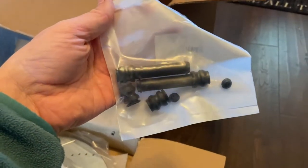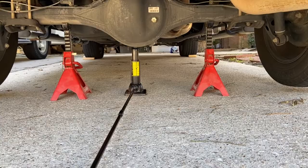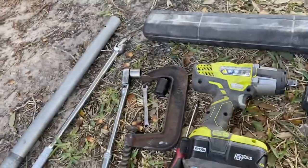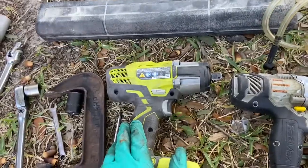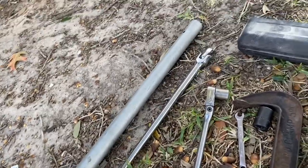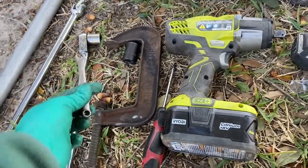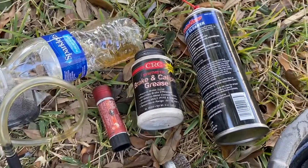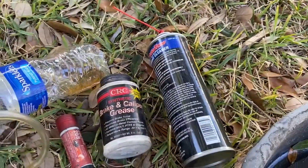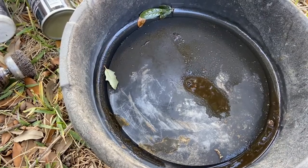Some rubber boots came with the kit, so we'll find out where those go. Car is jacked up with jack stands in place, wheels blocked. Tools you'll need for the rear brakes: 17 millimeter socket, half-inch drive impact gun — or a breaker bar and cheater bar — a torque wrench, a C clamp, an 8 millimeter open and closed end wrench, a wire wheel, Loctite, caliper grease, brake cleaner, and a pan to capture brake fluid when you clean the brakes.